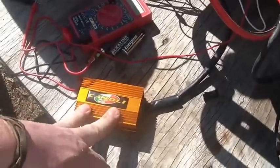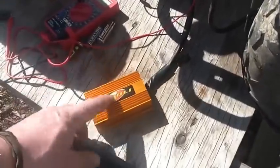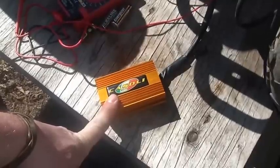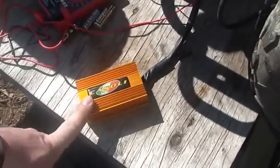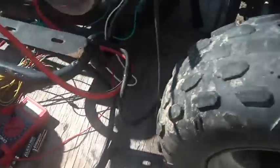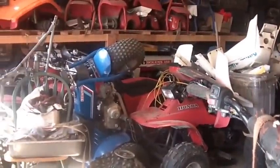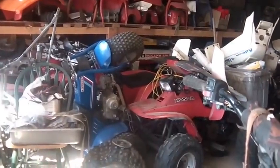I prefer to go with the 12-volt version. How much power do these things use? They use somewhere around 50 milliamps when the thing's not running, and if you are running it, it could use as much as half an amp. So they do draw some power, especially if you're really pushing it — you've got to allow for that as you're building things.